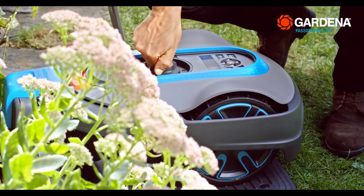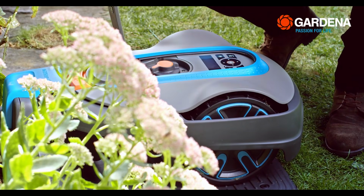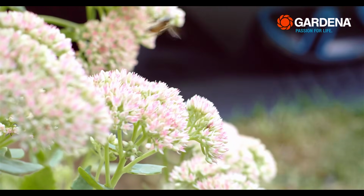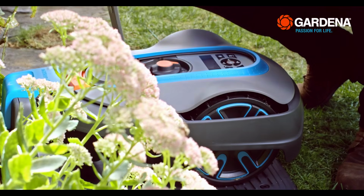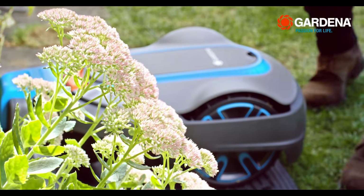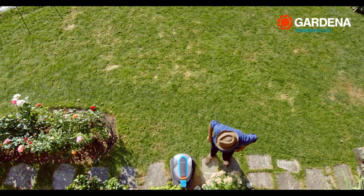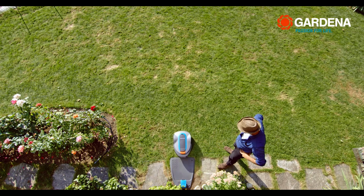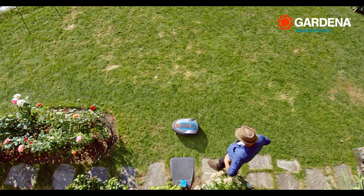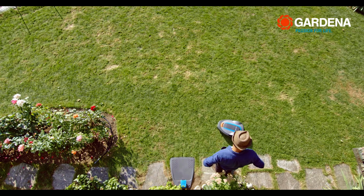First of all, set the cutting height to 5 so that the mower doesn't damage the wire as long as it is not being grown over. Then reduce the cutting height after a few days. By the way, before the first mowing, the mower also checks once again whether everything has been done correctly. To do this, it calibrates itself, runs to the end of the guide wire, and then starts mowing automatically.